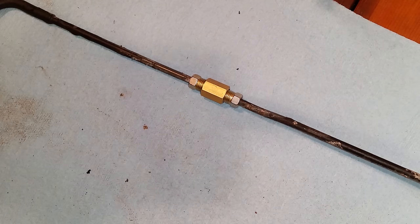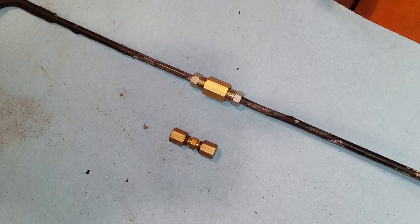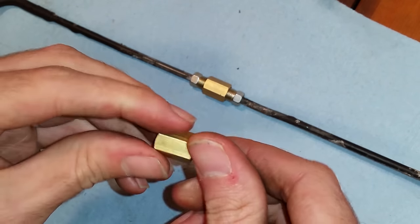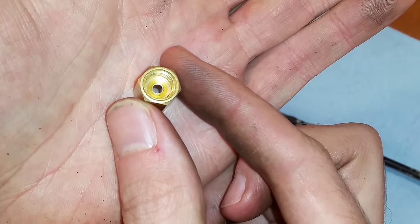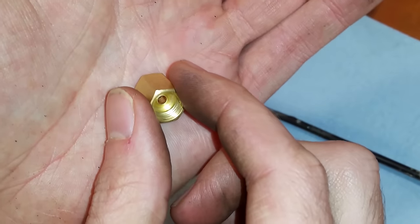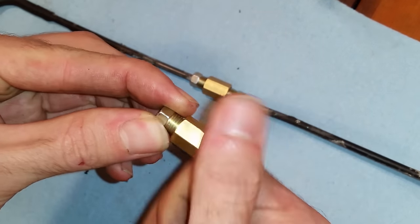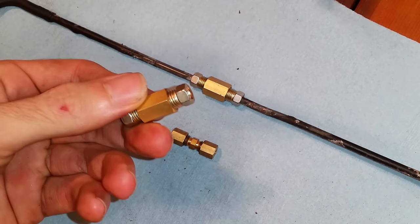There's something important to mention: what we use here is called a brake line union. If you look inside, you can see there's a seat where that double-ended flare we made sits down on both sides. This is one solid piece of brass. The fittings just thread in and you tighten them down snugly, just like you would any other brake line.